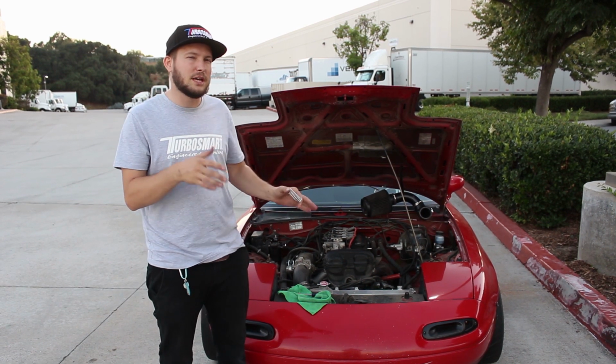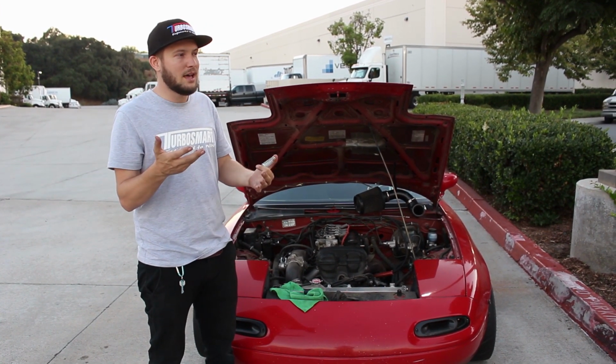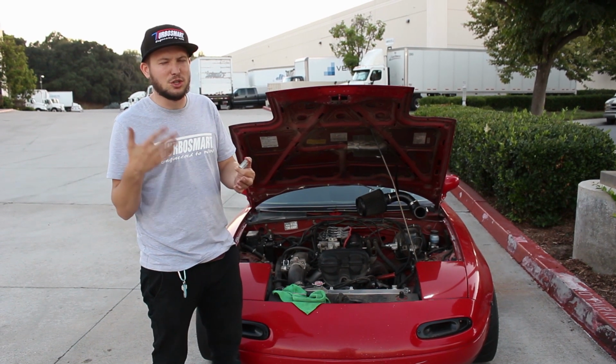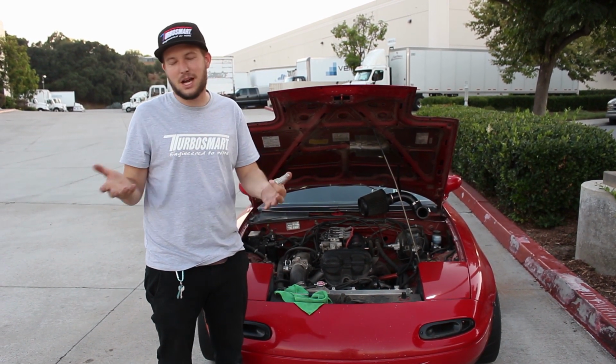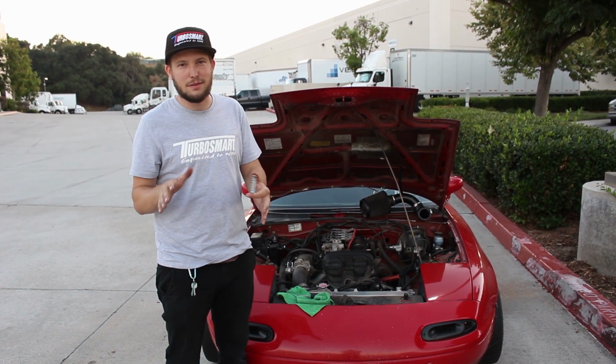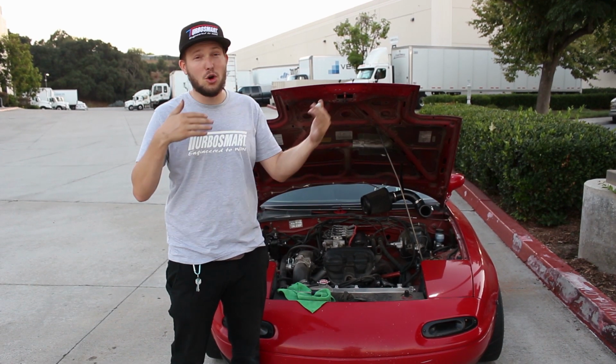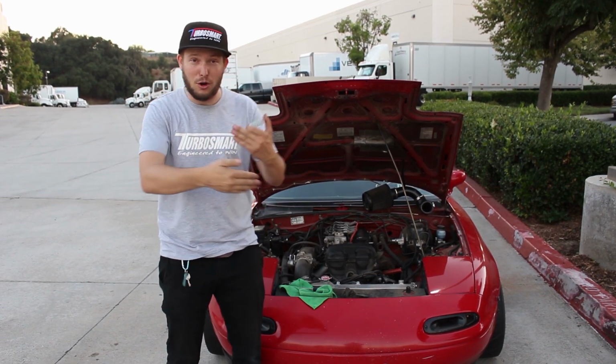But this being a recirc, it doesn't matter if it's open a little bit more often, and I like the softer spring, the way it sounds a little bit better. It's still got some flutter, which I think sounds cool, and at lower boost levels is not gonna hurt anything. And guys, the Turbosmart Compact Valve was actually co-designed with Borg Warner for their own turbo.